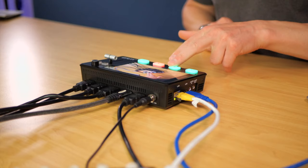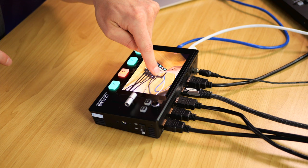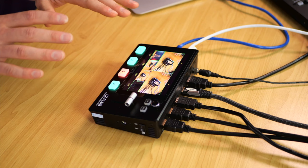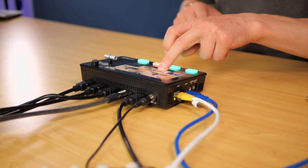Now you get a nice big display of exactly what's going on. If you want to get out of this, hold down again and it will go back into multi-view mode. That message that comes up on screen just tells you what mode you're currently in. When it comes to input and output frame rates and max resolution, this can support 1080p up to 50 and 60 frames per second, depending on whether you're in a PAL or NTSC region.